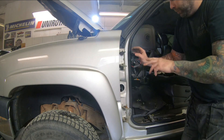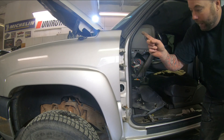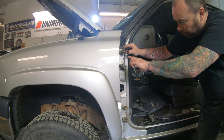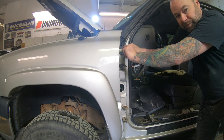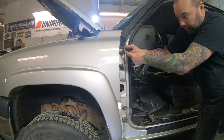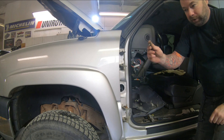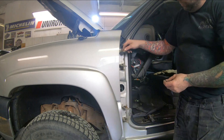This might not be the best truck to demonstrate on — last week's truck would have been better because it still had the factory pins. If it still has the factory pins, they don't have that c-clip. You actually need to take a grinder and cut the bottom off because they're mushroomed in from the factory. Just nip that bottom of the pin off without cutting into the hinge, then take a punch and tap them out because they're pressed in there pretty good.